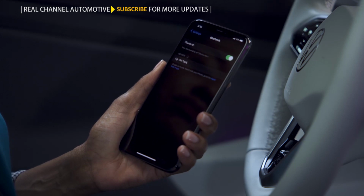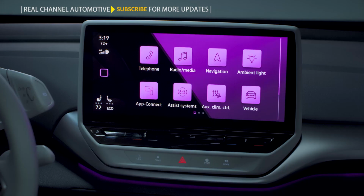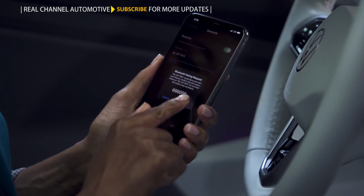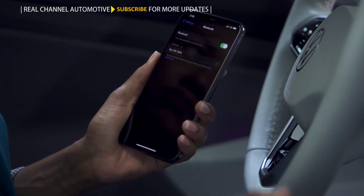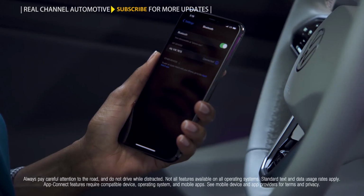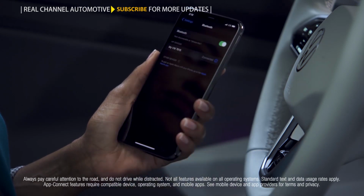Select the My VW connection, which will be followed by the last 4 digits of the VIN. On some devices, a PIN may be generated. If the PIN matches one on the display, select Pair. Agree to all prompts. A mobile device only needs to be paired once. Once paired, then you can activate App Connect. This will connect automatically after the first activation.